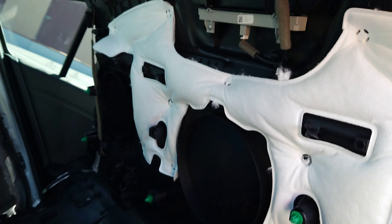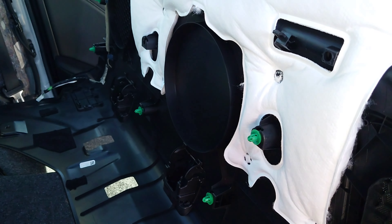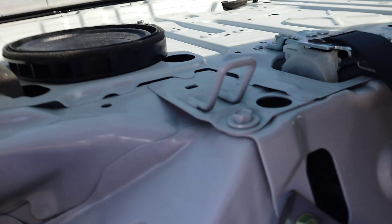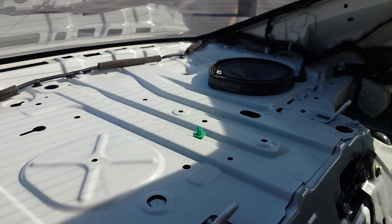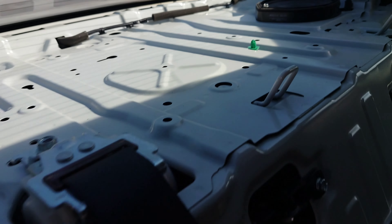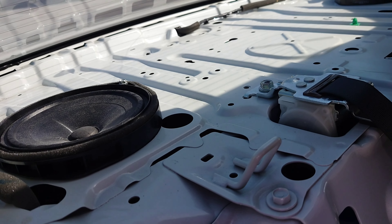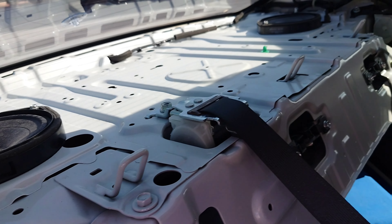There is one bolt here under this seat, so you basically lift it a little bit. See that? That's where the screw is. To remove the seats, the size is metric 10 for that one. Then if you need to, you can use a number 12 to unbolt the screw right here that holds these seats.